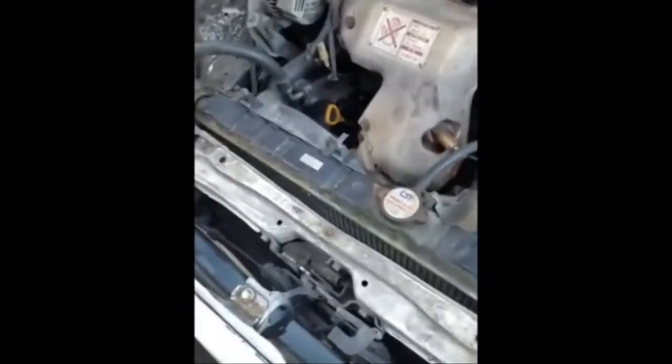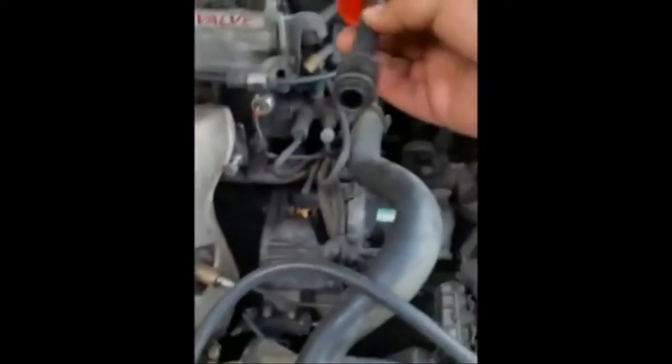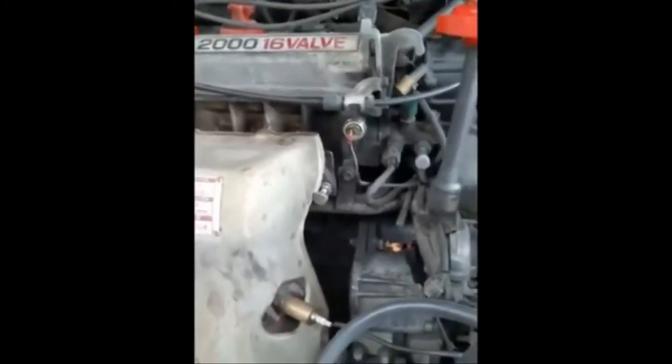For whatever silly reason the spark plug socket I have won't stick to these spark plugs. I remember doing this in the past and it worked, but I got the new one in. The way I got it in there: I used the old spark plug boot cable, put the spark plug in there, gently dropped it in, twisted it a few times to get it snug, then pulled the boot out. That way I don't just drop the spark plug in and bend the electrode - that little metal contact tip.